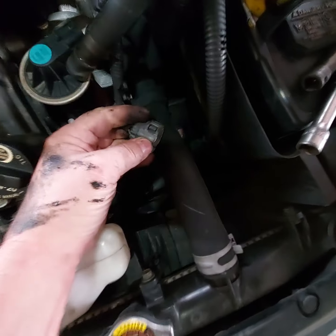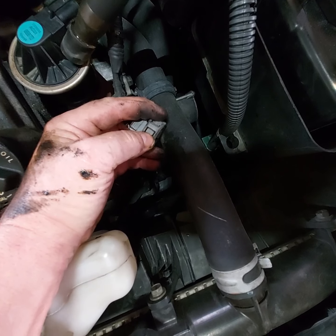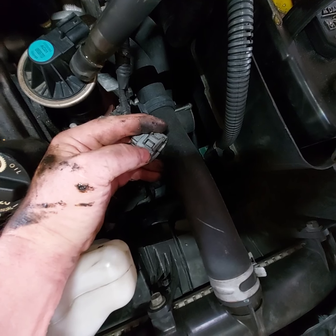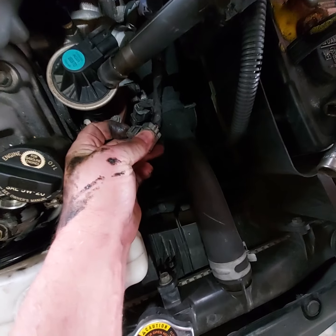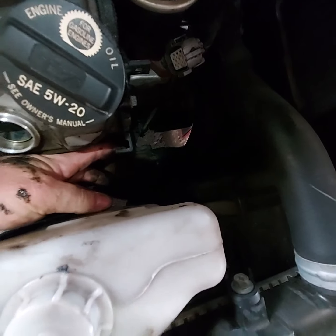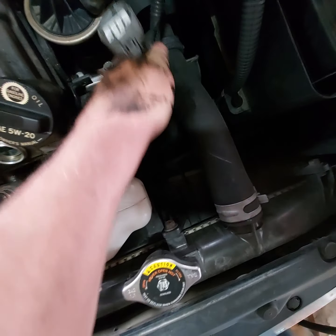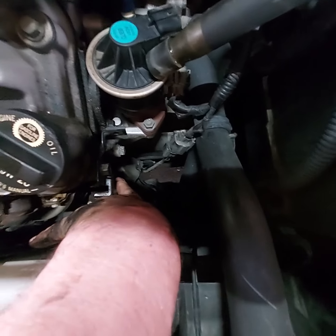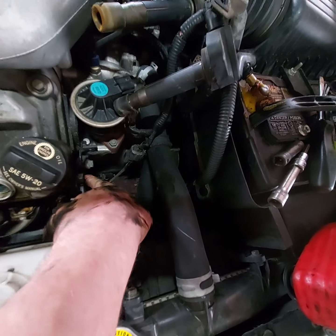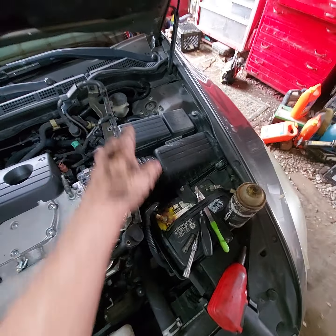On the bottom side there's a little tab — pull outward on it. Pull outward, and that releases the lock so you can slide it down off that little sleeve. For your oxygen sensor connector, it's got a tab similar to the other one, but you push inward on that one, and it slides down off of that little tab. I didn't disconnect it — I just released it from the loom holder. That gives me enough room to set it up out of the way.